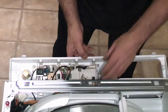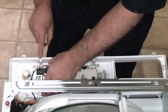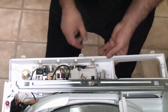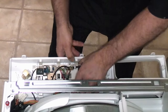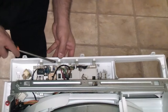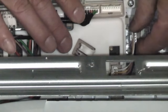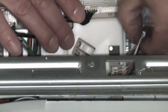Once you remove the three screws you should be able to get hold of the circuit board and simply pull that out. There are actually four plastic tabs at the top holding it in position, so gently ease the circuit board past each one. Sometimes it is easier to take a screwdriver and gently lever past the tabs. We also need to remove one electrical connector by pressing in the tab and pulling it off — it will only go back in one way.